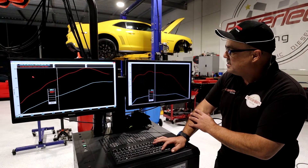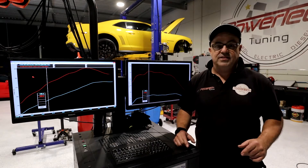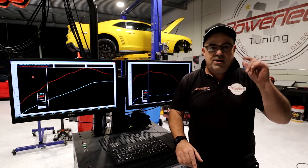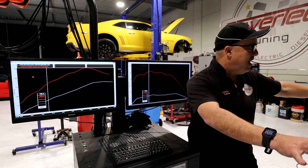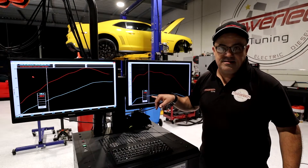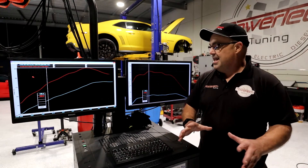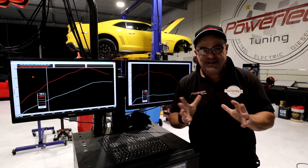Well, let's go back here to where it peaks. Standard it had 770 newton meters at all four — now it's got 1167. People are going to say, hang on, they don't make 770 newton meters stock, your dyno must be wrong. No, the dyno is correct. We run it in fourth gear, so the engine torque is multiplied by the gearbox ratio and the diff ratios and the size of the wheels. It's a mathematical calculation, but that's what you're actually hitting the road with — 770 newton meters in fourth gear at 3,500 rpm standard. But not anymore — you're hitting it with 1167 newton meters. Actual gains: it's called bloody big. Bigger the better when it comes to torque gains.